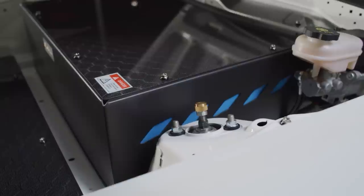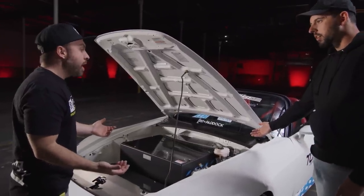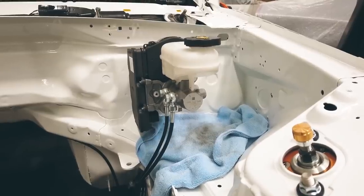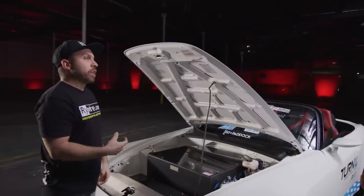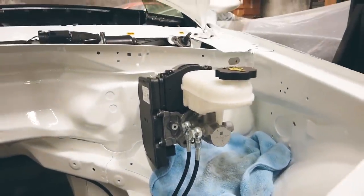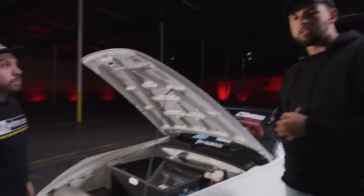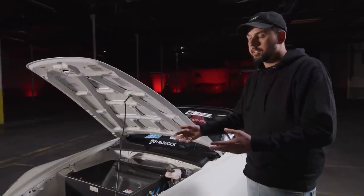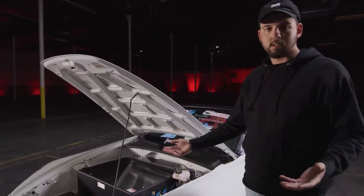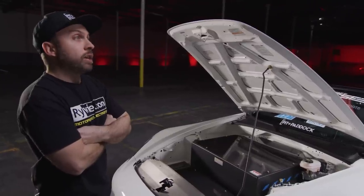Let's start with — look at that master cylinder. Can you even fathom what's going on there? It looks totally different. Is that like a stepper motor on there? So this is actually — there's like four or five factory production cars with these Bosch iBoosters. Because there's no engine vacuum for the brakes. There's actually an electronic motor inside of that booster with a master cylinder on it. So it basically powers on and then it's a little assist motor. Stuff you don't even think about when you're building a car like this — you don't have a motor anymore, that means no vacuum. Anything that operates on vacuum just doesn't exist for you. And it's rad that something like that does exist.